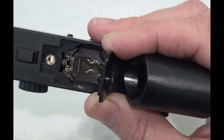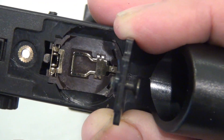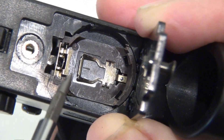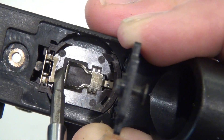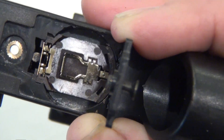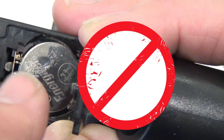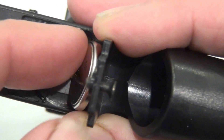Let's take a look at the details here. When I was changing it the first time, I did not notice this tiny retaining clip on that left side. If you're not paying attention and not careful, you can make a big mistake and damage that clip as you're trying to reinstall the battery — and that's exactly what I did. I popped the battery in and tried to jam it in, which you don't want to do. I ended up bending that retaining clip all the way down, and then the battery was loose in there, so I knew there was a problem.